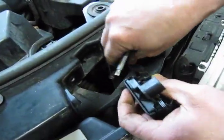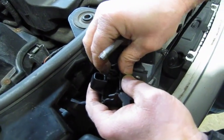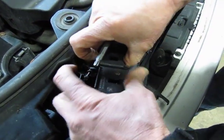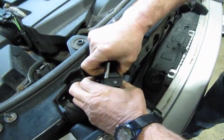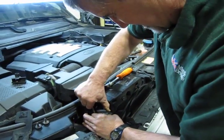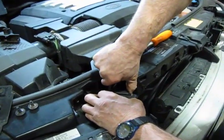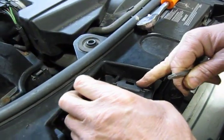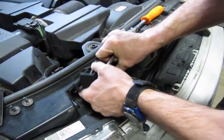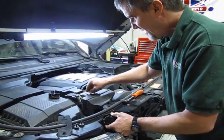Reinstalling is fairly easy. Simply squeeze that grommet back in where it was, and the cable as well. Some of these are a little stiff and you may want to use a pair of pliers to pull them into place, but make sure they do latch in. If they aren't fully latched and you don't hear that click, what may happen is once you get everything reassembled it'll fall out on you, and you won't be able to release this side of the hood.